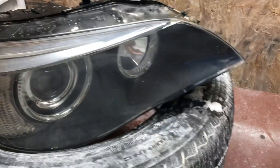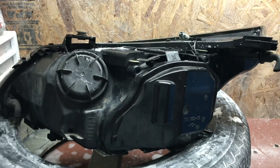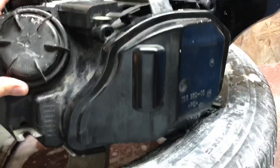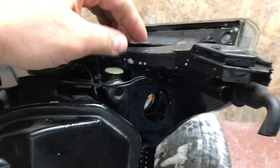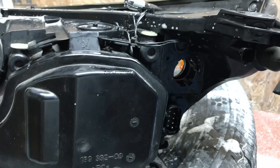All you're going to need is your headlight, a bucket with water and soap to make it foamy, and an air chuck. The first thing you want to do is make sure your headlight is completely sealed off. All the caps are on there — if you have any modules you can leave them on. You only want one spot to blow air inside, so that it gets pressurized and if there are any leaks, the bubbles will bubble up and that's where your leak is coming from.